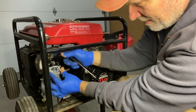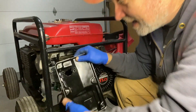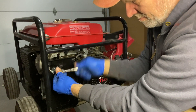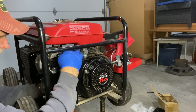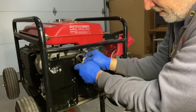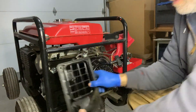We shove that back in — now this should run the choke, and I think that's actually going to be really good. Everything's installed and ready to go. Make sure you have a gasket on there — I wish they would have sent gaskets, but it's not major. Now we slide that shutoff wire up behind the carburetor. Let's put these tie-down clips back on — it's good to always put them back on because next thing you know they get caught somewhere. Now we can put this back on.